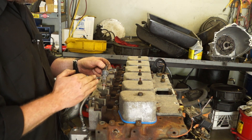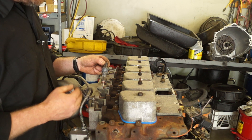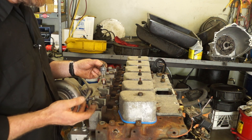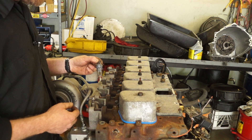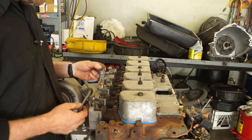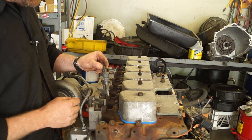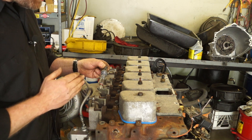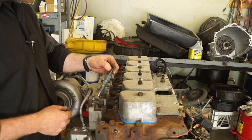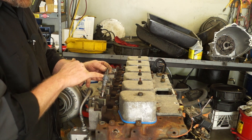On top of that, we had them custom set to the lower pop-off pressure to match the VE pump. Other options for VE pump injectors — there's a lot of talk about the POD injectors; those are okay, they're just a little bit too aggressive for my application. Nobody is going to disagree that the 215 factory style injector is a good injector for the 12 valve. If you guys want to purchase a set of these for your VE pump or even your P pump, I'll post the link to this hybrid style injector in the description.